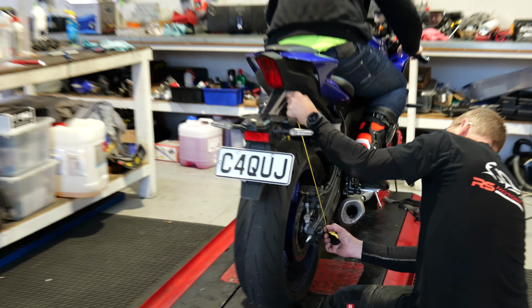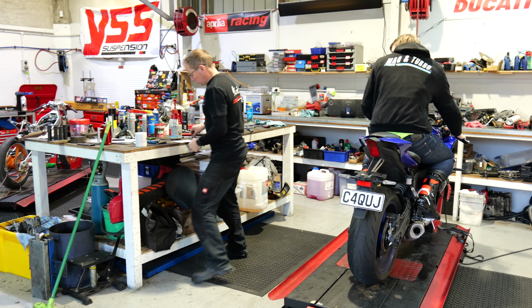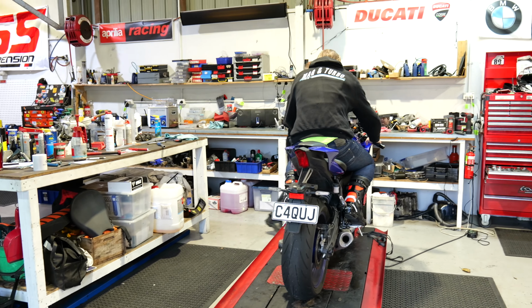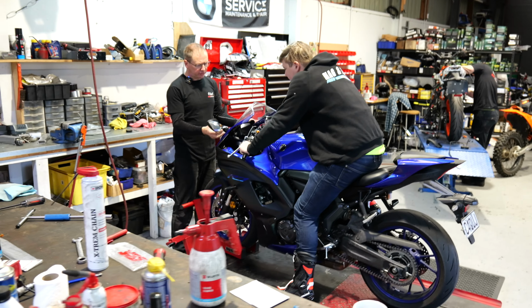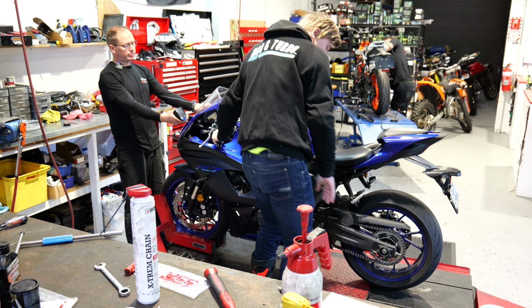And what are we at the moment? So 490. So as I said, we want that 30 mil for you. It's perfect. So remarkably, that rear shock on its softest setting is perfect for you. Yep. The forks, I've made a big adjustment. So if you hop off, and then we're going to do the damping.